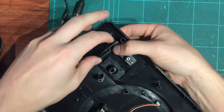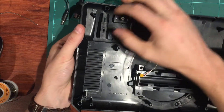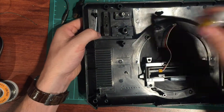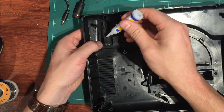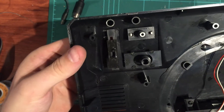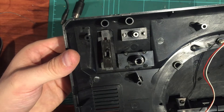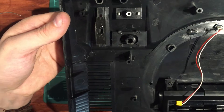Grab the unit with the volume slider in place, turn it over, and put the backing plate on. Be careful not to glue the whole thing down - that would be a nightmare. Just a tiny bit of plastic super glue - just a couple of dabs. I'm pushing up on it with my fingers underneath so it doesn't touch and set, so the whole thing still slides. You can grab a spare part or put the original back together and just glue it back into place.